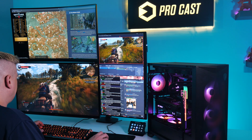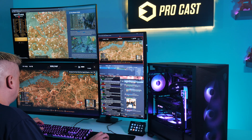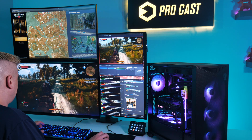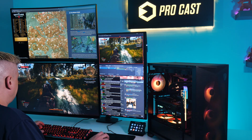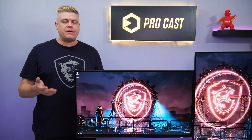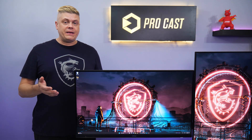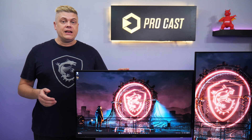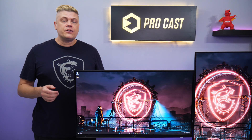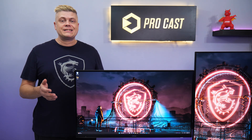Having a multi-monitor setup not only gives you a tremendous advantage for monitoring alerts, chat, what OBS is doing, and Discord, but frees up space, enabling you to provide a great stream experience to your viewers while having real-time interaction with your followers. While aesthetically pleasing, you don't need matching monitors, but your FPS may be affected. The GPU has to also handle extra screens — 1440p is double the pixels of 1080p, 4K is 4x 1080p, and high refresh rates are also a multiplier. You can try running non-game monitors at 60Hz, though different refresh rates can rarely cause stuttering in Windows.